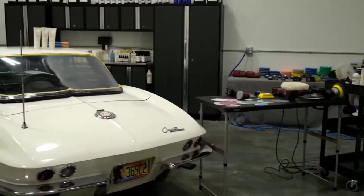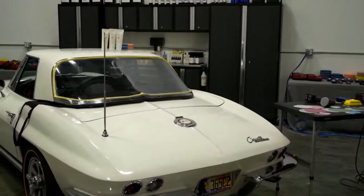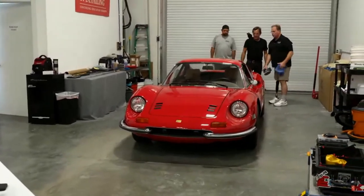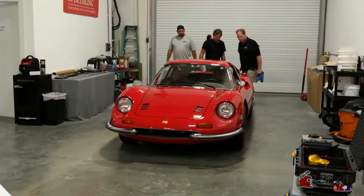Okay. Either he missed it, but I've got some of the paint that he just painted it with, and we can touch it up. Base coat, clear coat. Hit that little spot. And just put some clear. And then you want me just to lightly sand it with something like this, 3000 grit? Yeah, to go over it and just clean up a lot of this as you look across. Yep. A lot of the stuff.